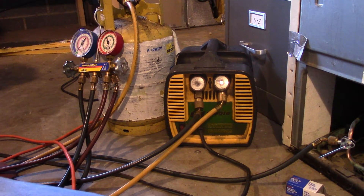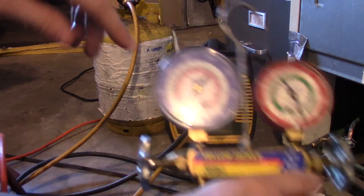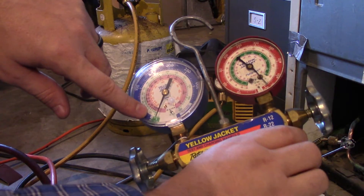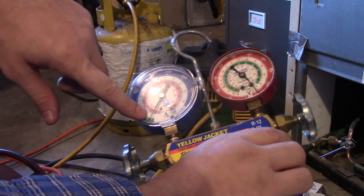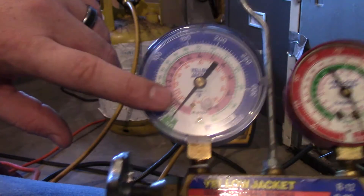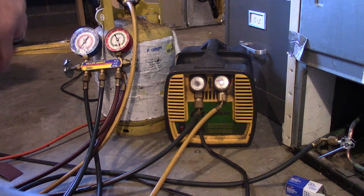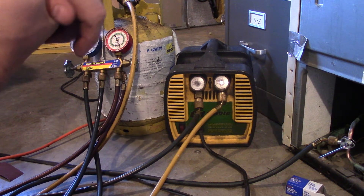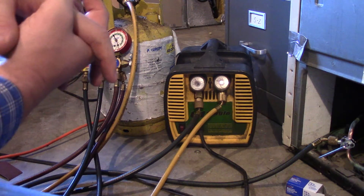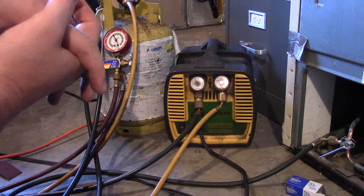Okay, so it's been a while and we're sitting here looking at this gauge that says about 25 to 28 inches of mercury — you can see that right there. We're going to let that sit for 10 minutes to confirm that it's staying below 10 inches of mercury. Once we confirm it's below 10 inches of mercury for 10 minutes, that means the system is ready for service and disassembly.